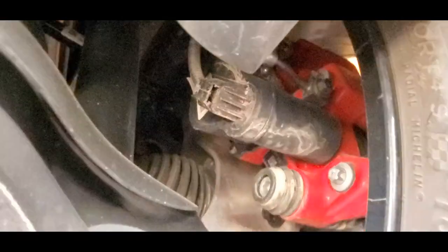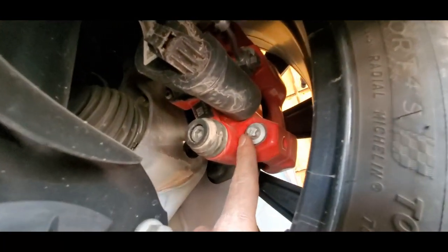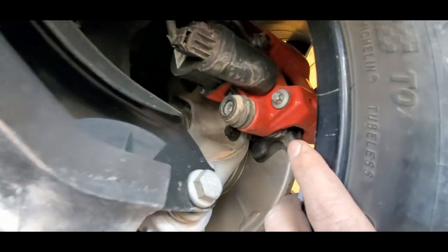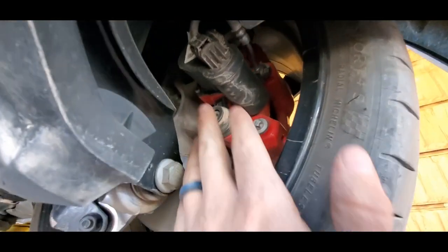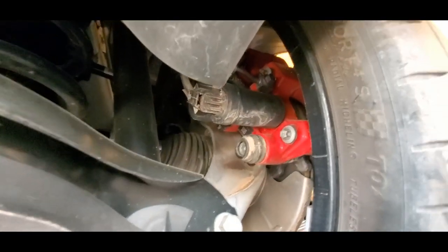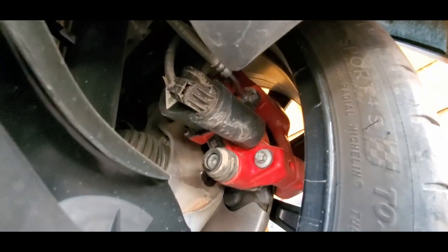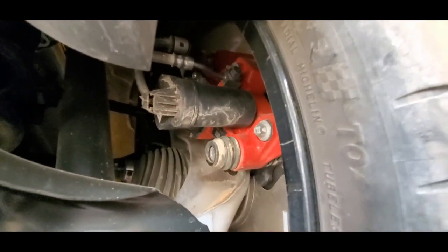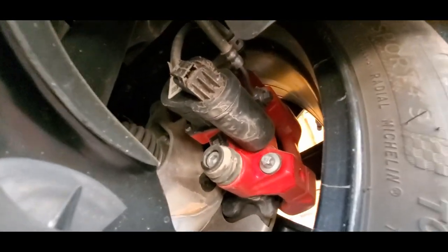Here's another neat little tidbit on the backside. Here you've got your rear brake caliper. So when you put this car in park, it actually squeezes the brake calipers with this little electronic actuator. There's no transmission, so there's no parking pawl, so I suppose that's how you park it. You can hear them making racket when you put it in park. That's different than a gas car for sure.